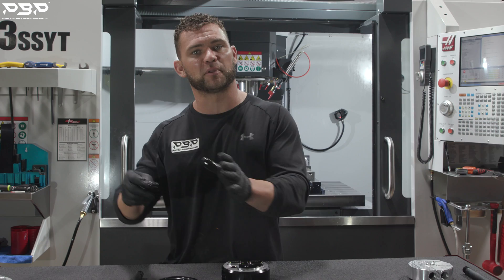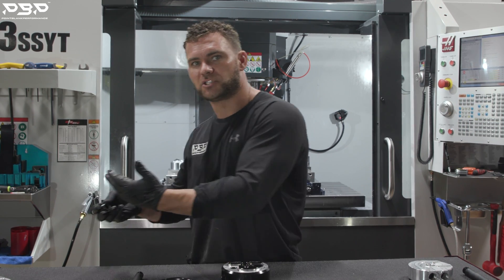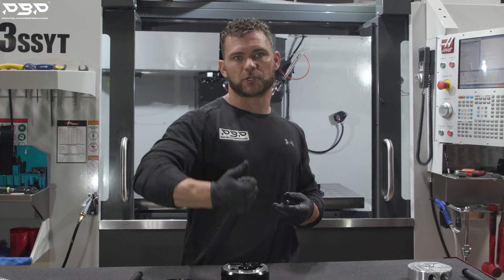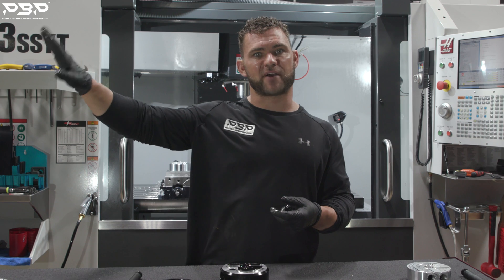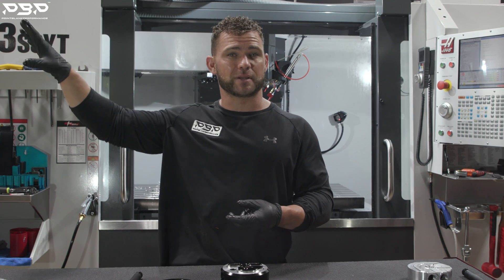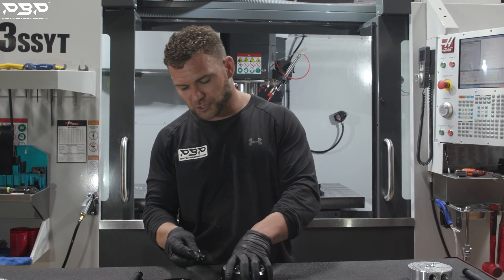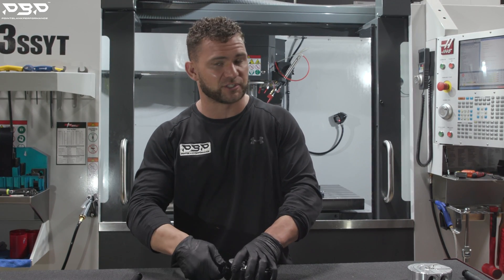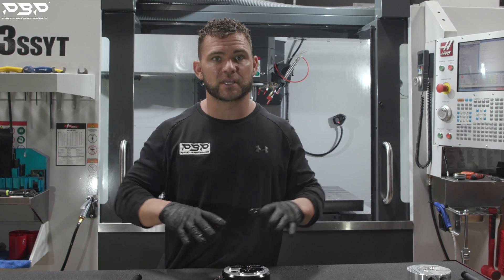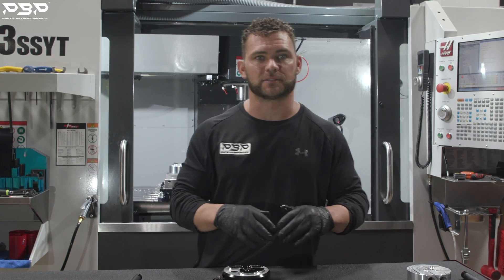So we've got the supply down at dash 10. What about the return? Because you're flowing a bunch of fuel back to the tank through our stand pipe. If that pressure goes up, then the fast fuel system will go up in pressure also. Your CP3 pumps will be very angry and the pressure goes up. So you've got to have zero restrictions in that return — we also have a dash 10. That's the big difference in fittings versus our baby Pac-Man sump.